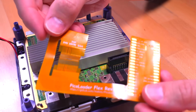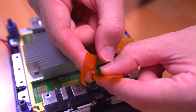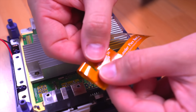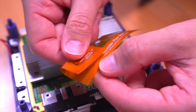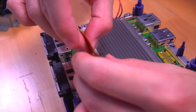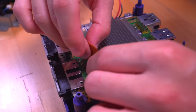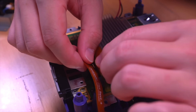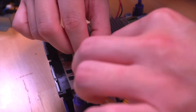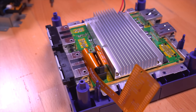With the optical drive removed, let's grab our flex ribbon cable. We need to fold it into a W-like shape as shown here. Do note that I have the DVD drive side of the ribbon cable facing upward when doing this. I like to gently crease the ribbon cable so that it can hold its shape — don't go overboard when trying to make the folds. Then, we need to insert the ribbon cable into the DVD drive connector on the motherboard. This is a bit of a fiddly process and it really only goes in one way, so just take your time and it should go in. Once complete, it should look like this.